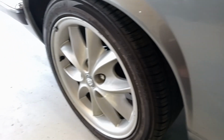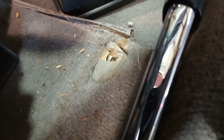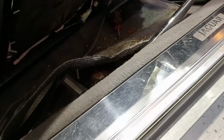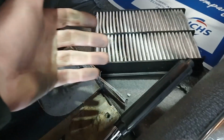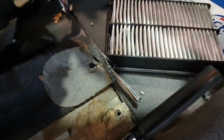And then what we're going to do is we're just going to jack up the back wheels so that they're off the ground, so that we can make sure that we don't over adjust and go too far. And we want to get maybe a few clicks, 3 or 4 clicks coming up on our park brake. Okay, so I've adjusted this up now to where it feels about right to me. More like 5 clicks if you really count them, but that's the position that feels about right to me.